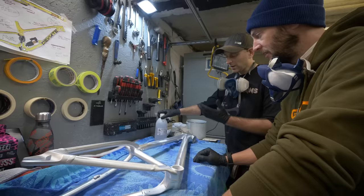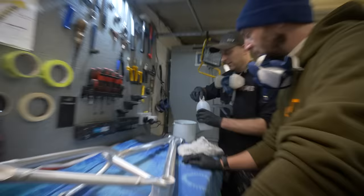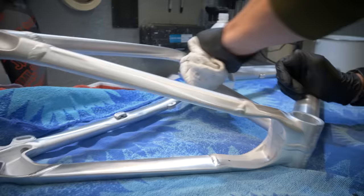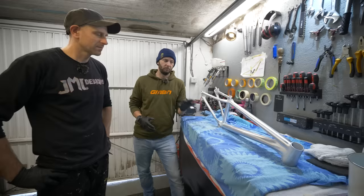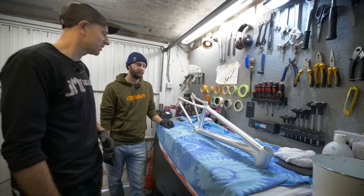Gloves on, because any fingerprints or oil on your hands will get into the metal, which you don't want for paint. To make sure it is super clean, you can get degreasers and alcohol cleaners. It's often worth wearing a mask with this kind of stuff. Just get a clean rag, put a bit on there, and give it a good old rub all over — it's purely to get grease, hand marks, and any contaminants that are going to affect the paintwork, because paint and oil and grease don't go together very well. She's prepped and ready — what's the next stage? Next step: make sure you're not getting paint in threads, down tubes, or in important areas, so masking is the next step.